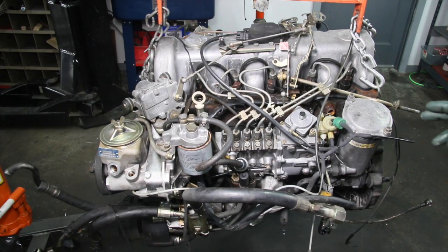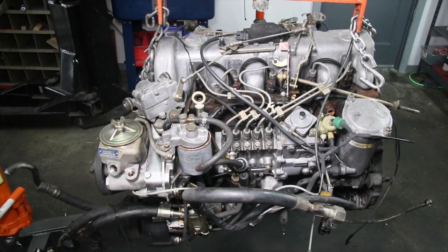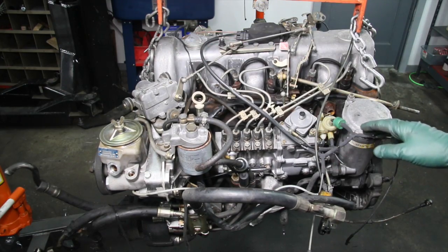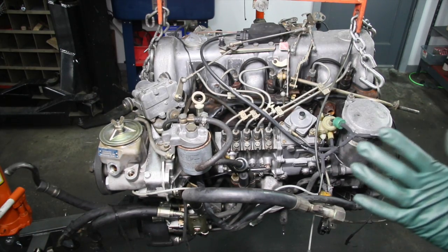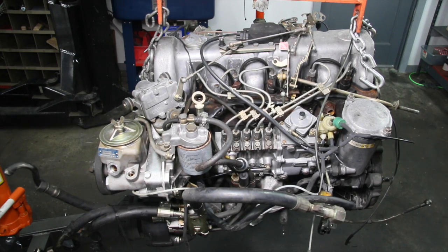There's one subtle difference in the belts for the alternator. When you make the swap, you're going to have to remember to order 300SD alternator belts, not 300D, unless you change the pulleys. So that's about it — you can see there's not a lot different, but there are just a few things you're going to have to swap out.